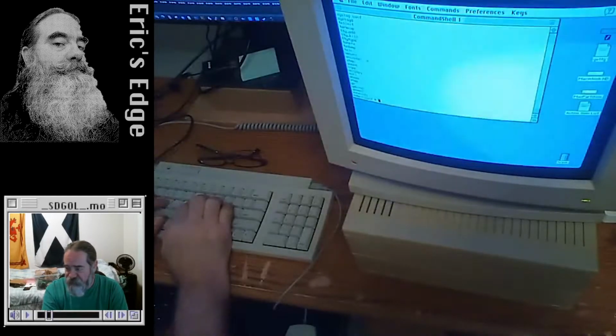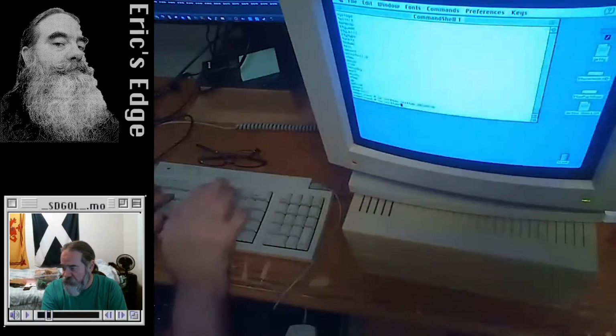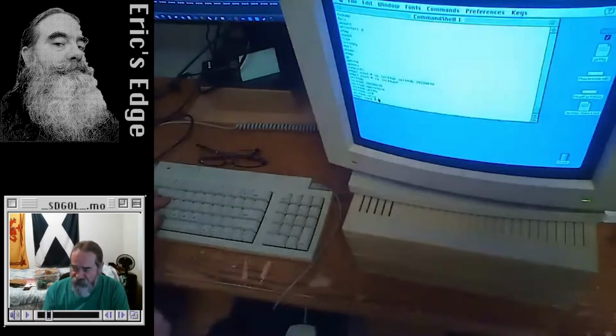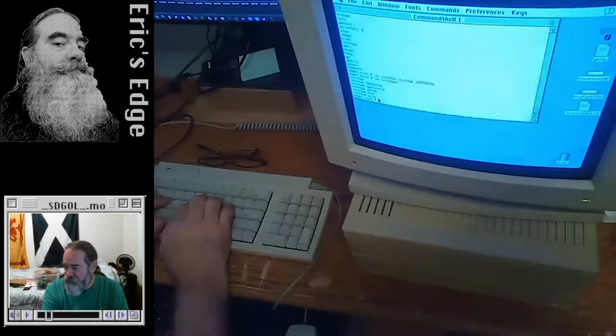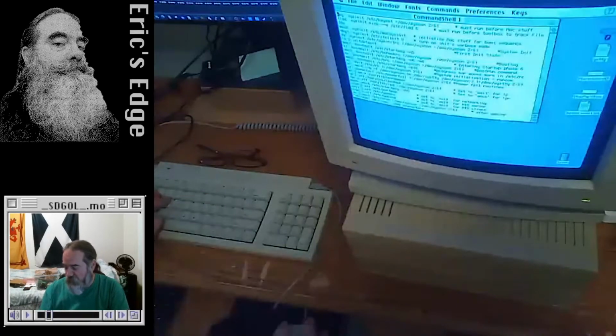First, I'll make a copy of inittab: cp inittab to inittab.20220810.nos, inittab star. Okay, you can see I had it set up so that I had an inittab that enables AppleTalk and another inittab that allows me to do serial communication. Hacker. Yeah. All right, so vi inittab. Boom. Let me make the screen a bit bigger.